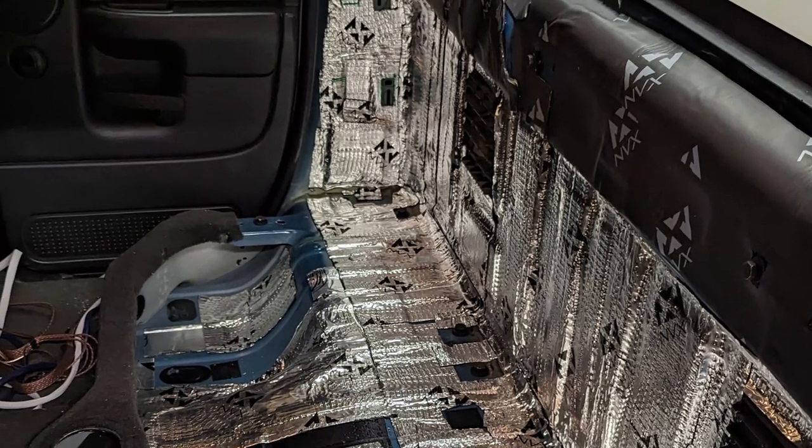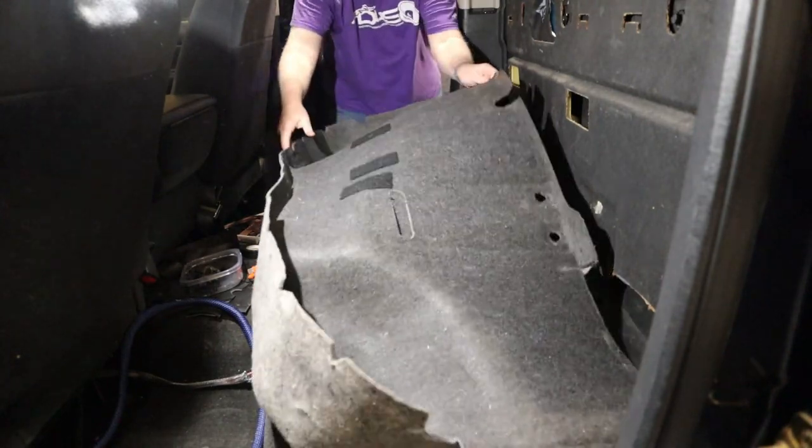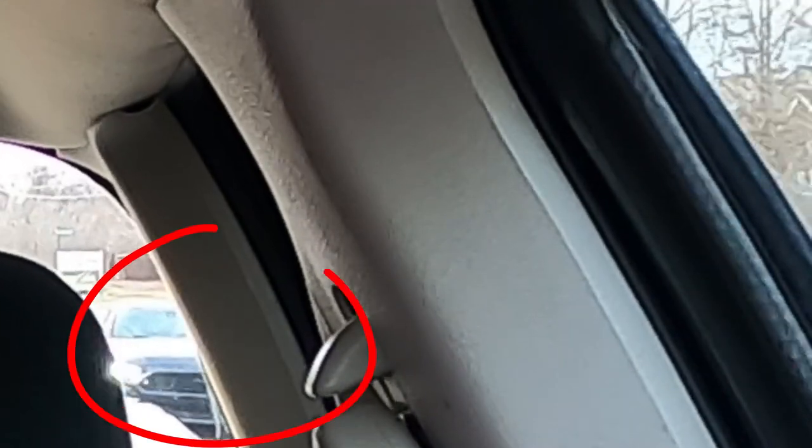I'm wearing a different shirt so you can tell it's a different day. I didn't get footage of putting the NVX sound deadening on the back wall and floor, or of replacing the original mass loaded vinyl and closed cell foam. My intention was to get a before-and-after measurement. My reading is 71 dB — so the mass loaded vinyl rejected 12 dB of road noise. It's never going to be as quiet as a luxury car, but I need to get road noise down to the point where I can stand to drive the thing. I've still got more material to add, including the D-pillars, plus the flat floor and flat wall to mount the subwoofer box. By the time I add all that it'll probably be a whole lot quieter. If you want to see that, hit the subscribe button. I'm Justin, the DIY audio guy, and I'll see you on the next adventure.